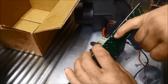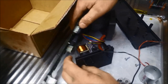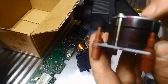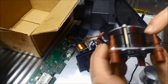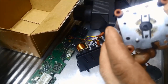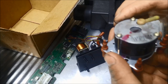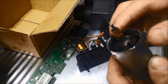Okay, I've unsoldered the motor wires, plus here, minus here. I've got that out. And I've also marked everything just when I pull it apart. There's a little pump in there. Apparently you don't use any solvent or anything in these, because the material's got the lubricating part for it. I've just put it back together just so I know how it goes back together. Just temporarily, there are little vanes in there. And I've pulled the motor apart.